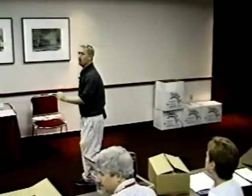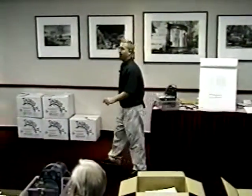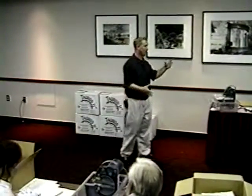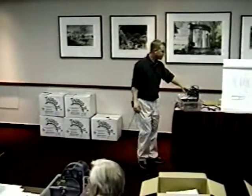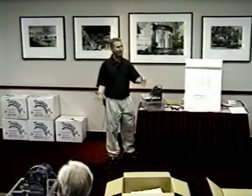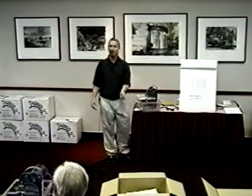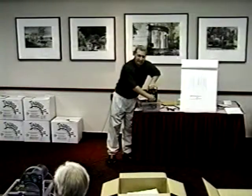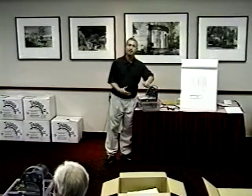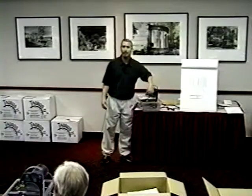We're going to loosen the tension. Remember, it's only a matter of millimeters — just a little bit. We're not manhandling it, we're not changing the whole shape of the saw. We just want to loosen it up. We've got a 10 — this thing isn't moving. We've got a 9 — it's barely moving. We can make it work, but it's hard. We push down and that feels about like a 5. Your 5 is going to be different from my 5. We want it to move easily, but feel the rubber of the belt pulling back.